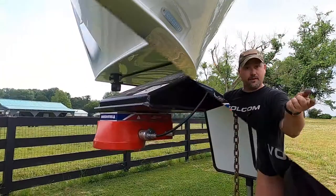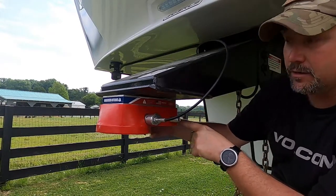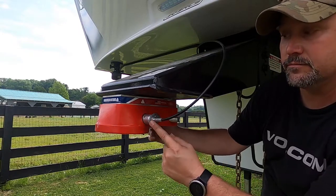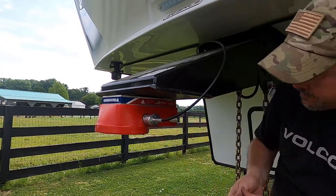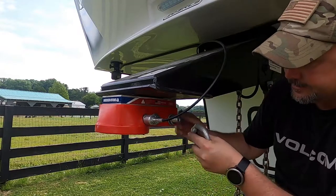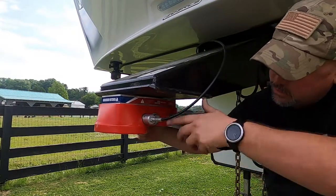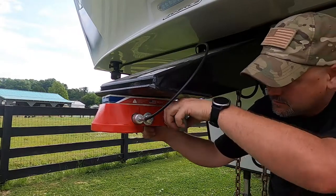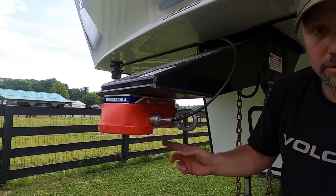We need to make sure that locking mechanism is locked too — it can back off every now and again, so that's another thing to check. On this side I've got one flat washer, and on the other side I'm going to put another one on with the lock washer. All you want to do is snug these up — make sure they're secure and tight. There's no torque value for these because you don't want to crack the plastic. Always make sure they're straight up and down — that's my preference.